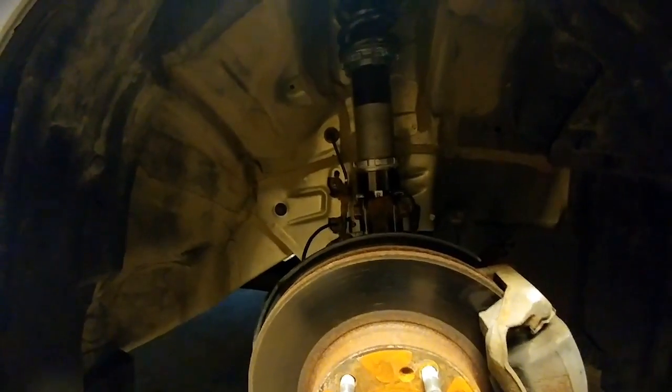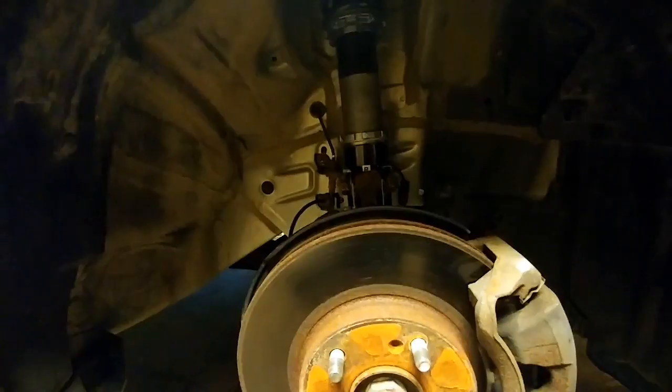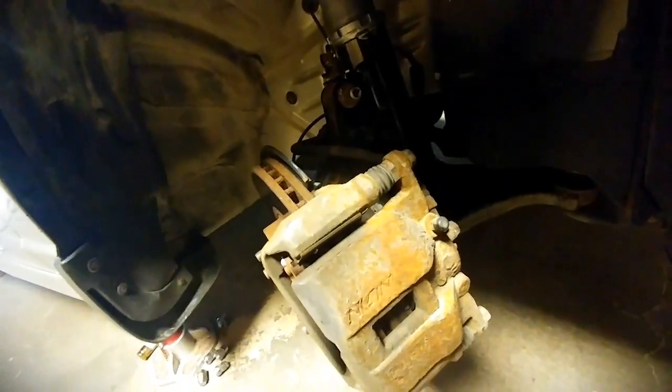Spring rate is 8K in the front, 6K in the rear. Dampening that I use is 20 up front, full stiff in the rear. I like a bit of a firm ride, but if you put it to, say, 5 clicks in the rear and 0 in the front, you have a grocery getter. Stay tuned.